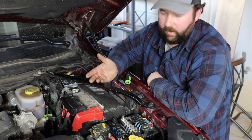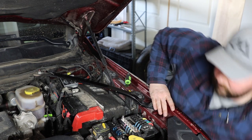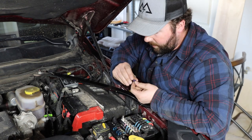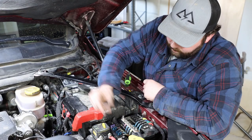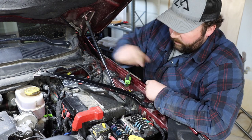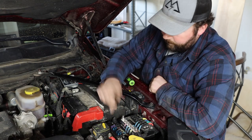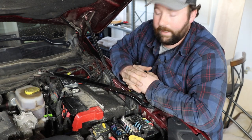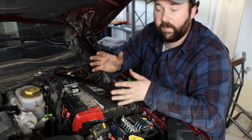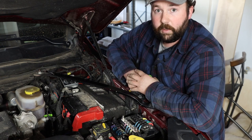For this last step, regardless of whether you have a powerhouse or the inline fuse system, take the provided 3-amp fuse. Note the switch may be on or off, so when you plug this in those lights may come on — don't freak out. Mine is in the on position. Flip it around to read it better and get that 3-amp in there. To control your engine lights, all you do is press that button — super simple. Your installation of your engine light kit is now done. Go ahead, tidy up anything you need to, and make sure you didn't leave any tools inside the engine bay.